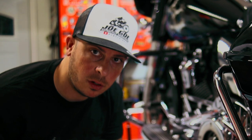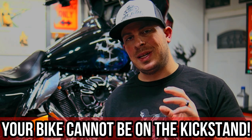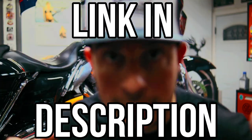We're going to go ahead and start off with filling up the primary. When you're filling your primary, you have to make sure your bike is straight up and down. You cannot do this on the kickstand. If you don't have the Condor wheel chock like I do, link down in the description, you might need somebody to help you with this.